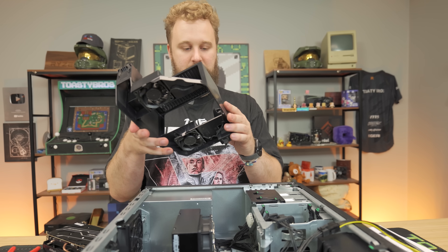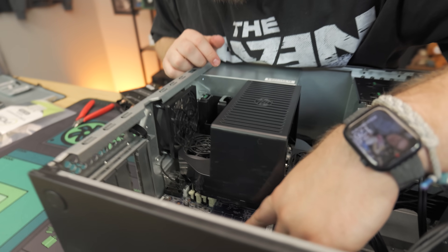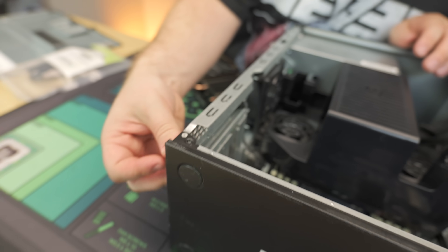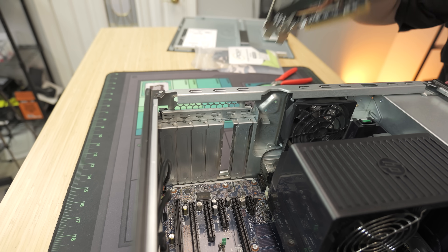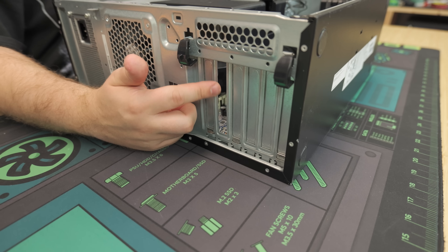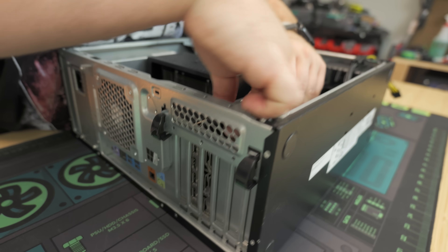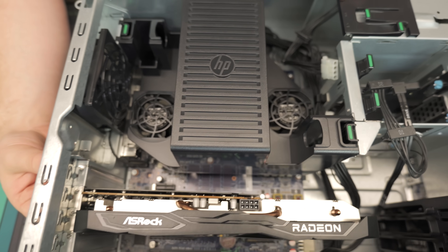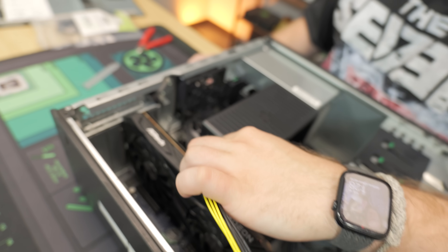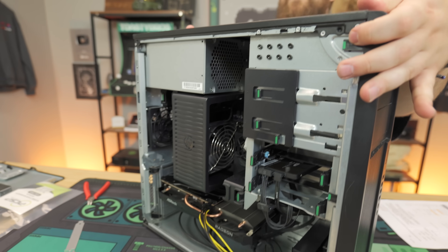We're going to install our graphics card in the PCIe 3.0 x16 slot. We open up the back by pushing down on the tabs to release the cover over the PCI slots, then check where the GPU lines up on the top-most slot. One bracket was already out since there was probably a basic graphics card in there originally. We remove the second bracket, take our graphics card, line it up, push down, and it's installed. We push the cover back over top to make sure it stays, then plug in the 8-pin power connector. Just like that, you have a PC for $340 that can game.